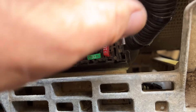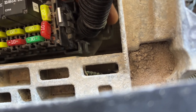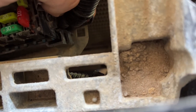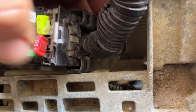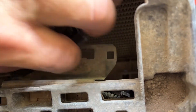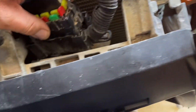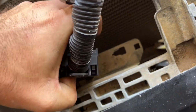Here's our fuse box, and right down here under the wire harness there's a tab. What you're going to want to do is push that tab up and then slide the box over — and it releases the box from the bracket. See that little tab right there? Push it up and push it over — you can see it pushes it out of those little spots where the tab locks in.